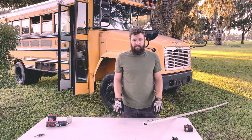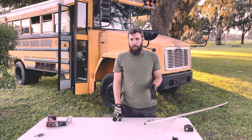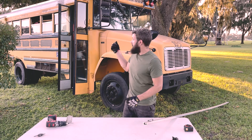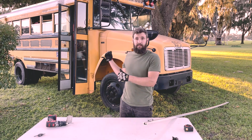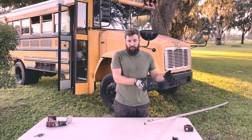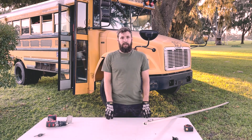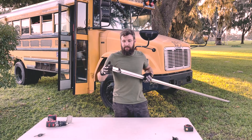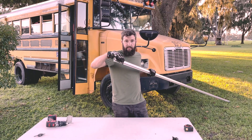A few notes about this system: I've got it on 40 to 50 buses. I've sold the rails to a handful of people who've installed them without issue. One downside is it's hard to find locally and expensive to ship because the rails come in 14-foot and 17-foot lengths. I just installed 17-foot, which will give me five panels consecutively, assuming you're using panels in the standard larger residential panel range. The 14-foot rail will do four consecutively. They're also designed so you can connect them in continuity — for full-size buses I'll often install two sets of rails the entire length for up to 3000 watts of solar.